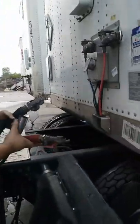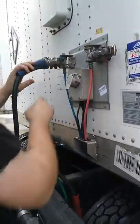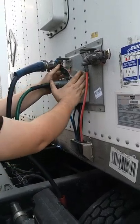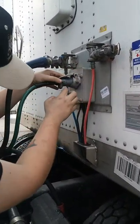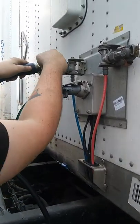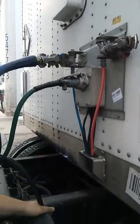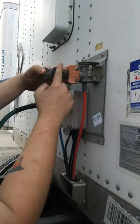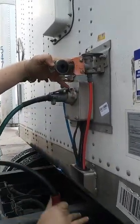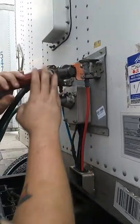Spin around — blue. Now, make sure you look this up, push that all the way in so that way the little tabs meet. Same with the airlines — make sure there's complete contact right there between the two flanges. Also, you're going to want to check your grommets here. Make sure they're not cracked, worn, or frayed. That's going to be part of your pre-trip test, by the way, if you go to school.